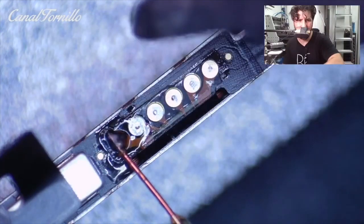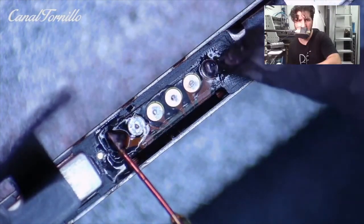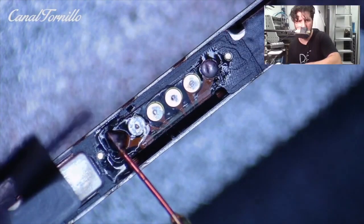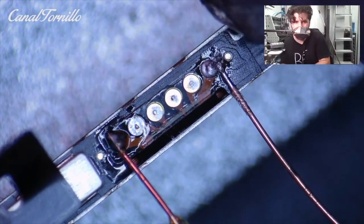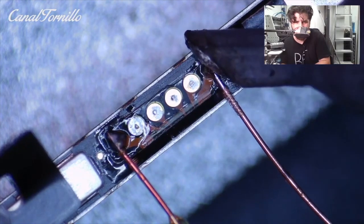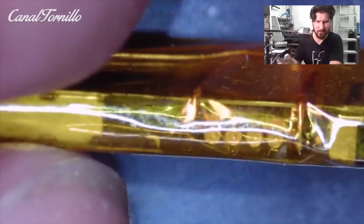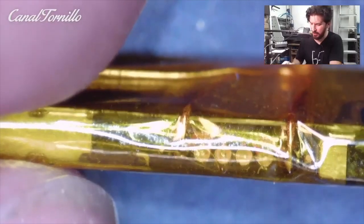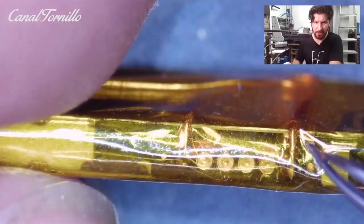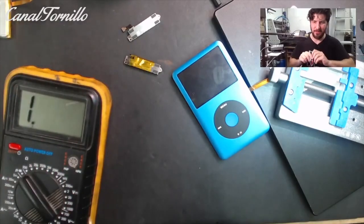I'm using a 0.2 mm varnished cable so that only the tip makes contact, and the insulation preserves the thickness of the plastic sheets of the cables. Do not apply heat to these tracks for more than 10 seconds or they can be damaged — let it cool and try again. Wrap these cables in kapton tape to avoid accidentally pulling them and splitting the Taptic engine tracks. They are very delicate — don't ask me how I know.